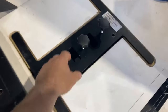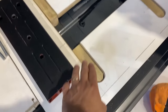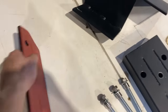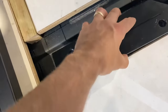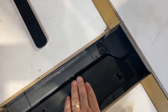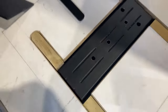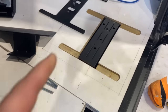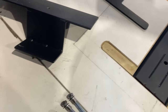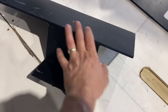If I lift up the base plate, you can see I've cut the shape out of the 18mm plywood floor and I've used these bits of CLS as packers. The spreader plate sits in there bringing the floor level with this area, and then the box section sits on top like that — which is what the actual H base plate sits on. It's all metal-to-metal contact, and then underneath the van the bolts with washers are going to capture onto this spreader plate.